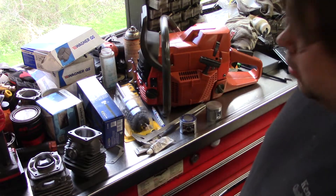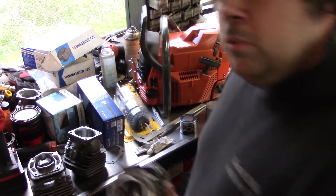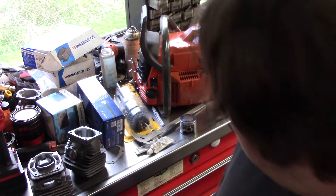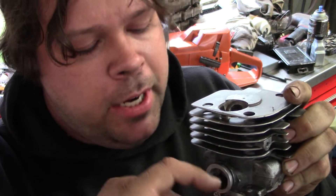You've got to use the JB Weld — you're going to need JB Weld. The intake as well, which isn't that hard. What you do is make sure you don't wash this with anything. Grind fresh material out with the grinding bit, make sure it's pretty rough.